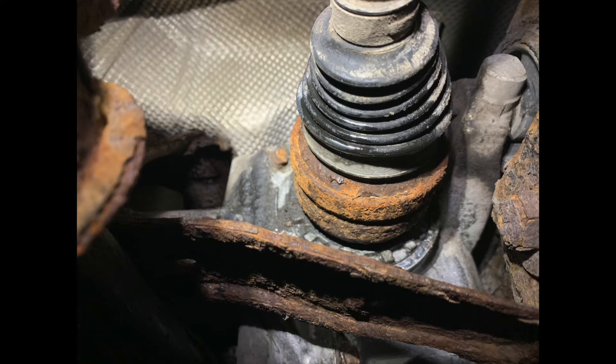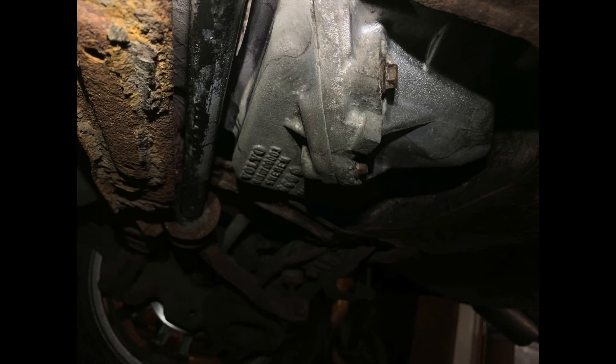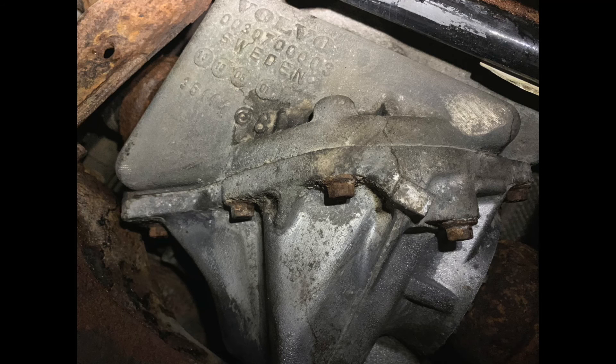In this photo you can see the surrounding part of the axle that goes into the diff — this is as clean as I could get it, and it was enough to show whether more oil came out or not. Here is a view of the diagonal cut on the rear diff where the differential housing is; that gasket can also leak. It was not leaking on this car, but that's one reason to clean everything up — to see if it's leaking from that seam right there in the middle of the picture. Here's another look at the diff from underneath after it's been all cleaned up.